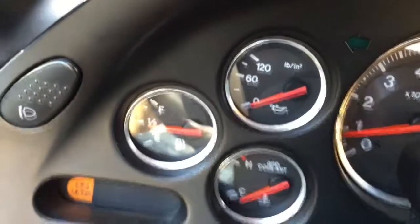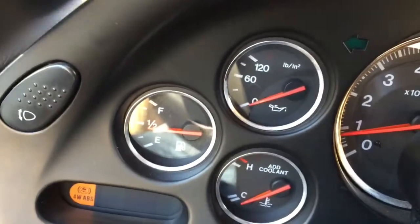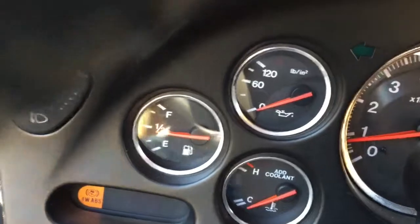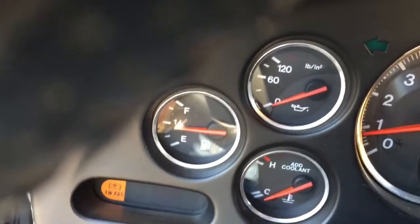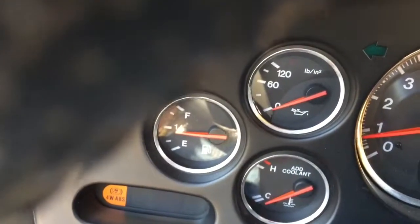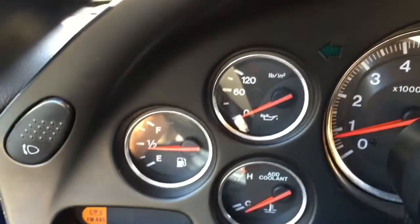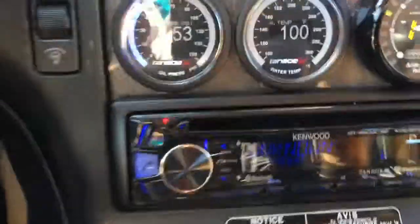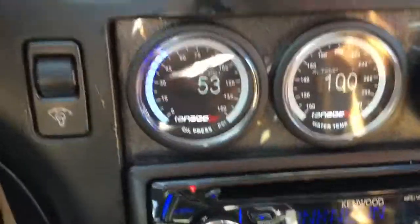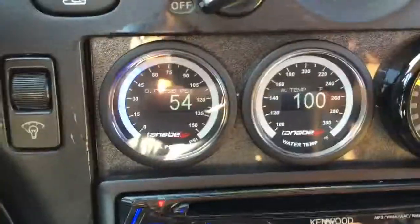You don't really know what's going on below 60 PSI with the factory gauge - it's either on one of those four bars, so anywhere in between you don't know what it's doing. The stock oil pressure sensor on the FD is like maybe 120 bucks, and that's all you get. Any cheap aftermarket gauge is about the same price and you get more accurate readings.